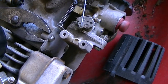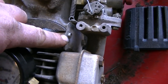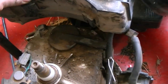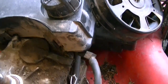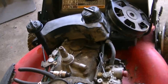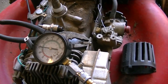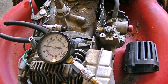So what I'm assuming, I won't be able to check it. They put a cover right here, but it's usually for the crankcase ventilation. This is a solid plate. Here is your crankcase ventilation. If I can move it, you can see it right here, and it connects to there, which just blows right back into the carburetor. So my first assumption would be that it is plugged up and it can't release it. He didn't tell me if it was knocking, smoking, or what. It could be a bent crankshaft. I haven't checked the crankshaft on the other end yet to see if it was bent.